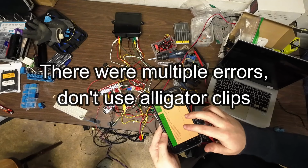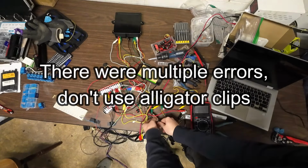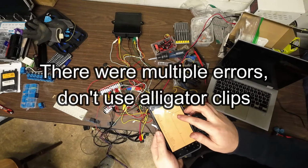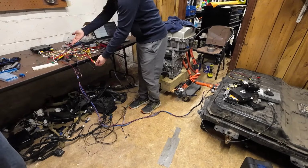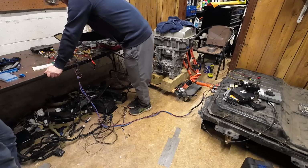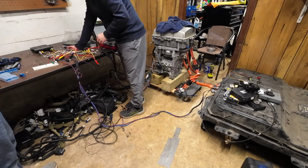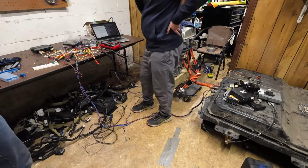Charge type AC. Why is it trying to charge? That's weird. Well, let's set it into start mode. Interesting, it's trying to charge. Status UDC below UDC switch, pot pressed. Now, on, relay click, connected. Okay, no, it gave us the same error. Stop pre-charge. Oh, now it says it's off. Now it went back to pre-charge fail. Okay, so obviously we have something not connected.